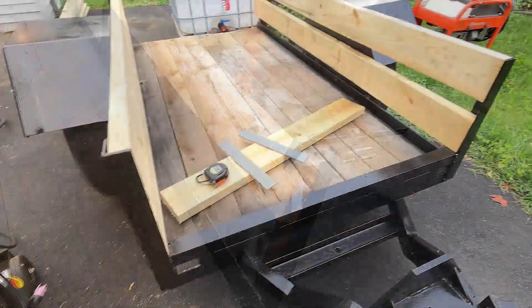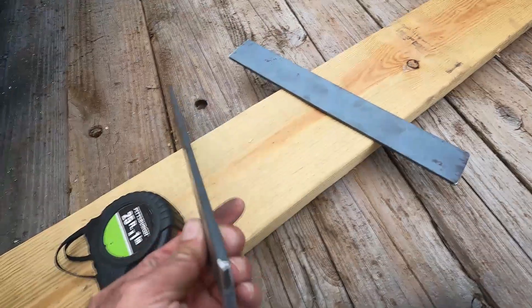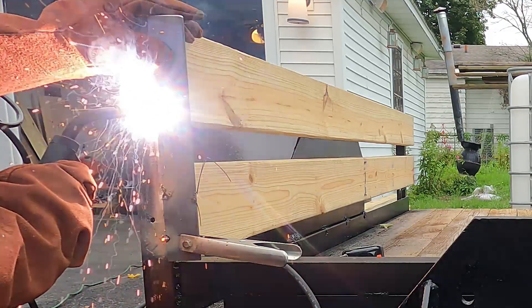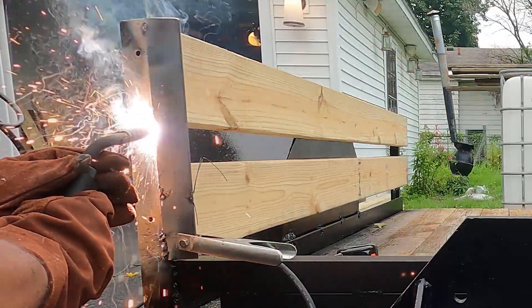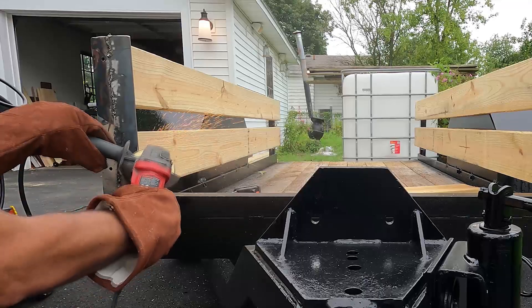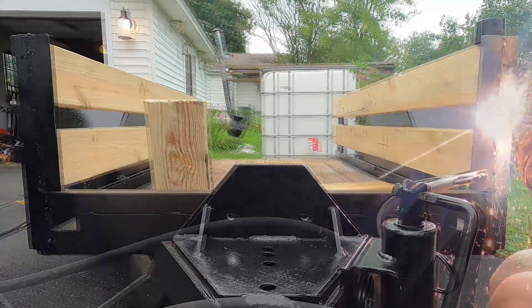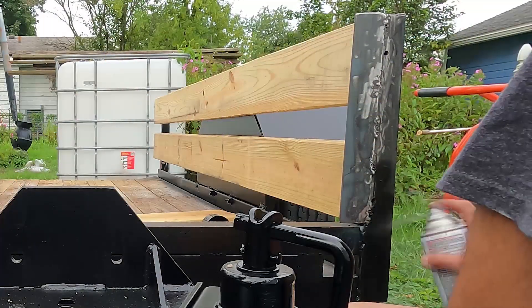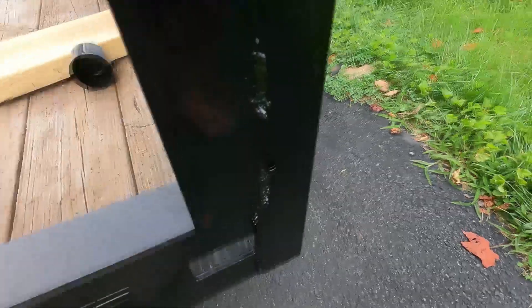With a few taps I sent it home and the sides came out great. What I realized was that for the front of the trailer I didn't have anything great to anchor the wood to, so I cut down some pieces of steel and welded on some tabs that went the full height — bottom to top — at the front. Using the same stitch weld technique, I ground them down and painted them. The strength of these welds is really good — I could grab these tabs and shake them violently and all that happens is the trailer moves. Definitely on there well enough for some pieces of wood.